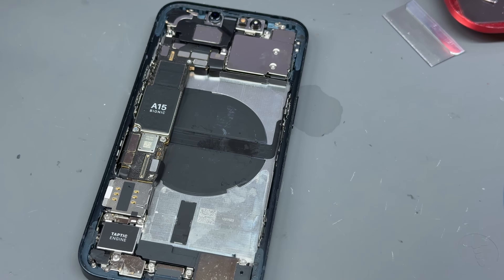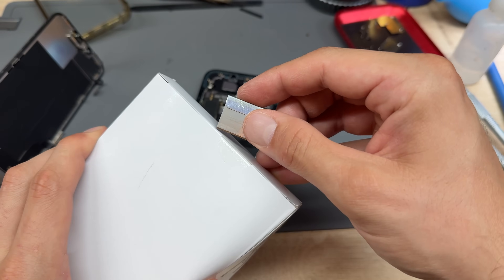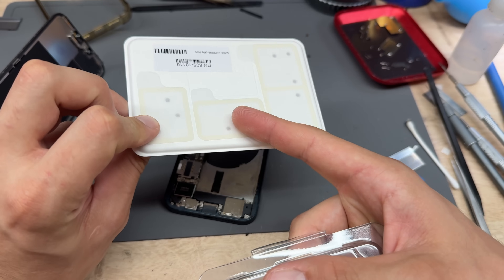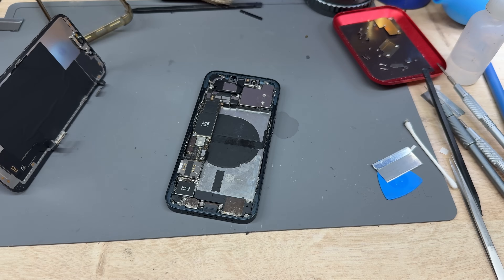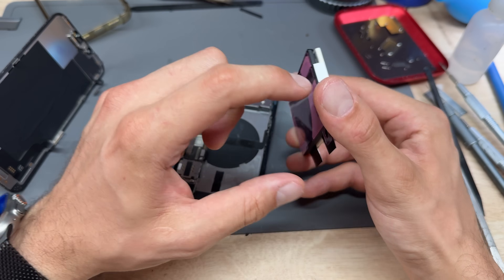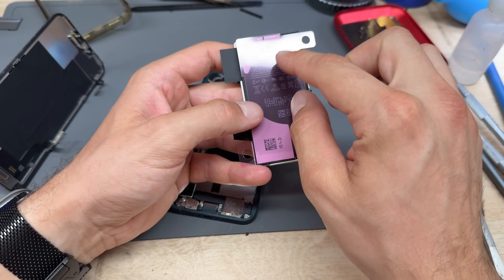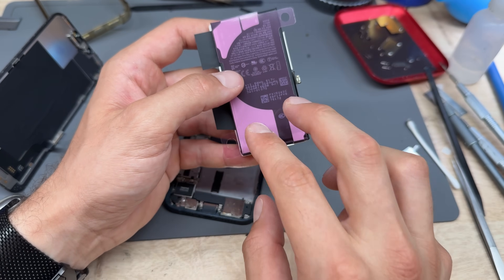The new battery that we're using in this video is a genuine Apple replacement battery. This video is sponsored by MobileCentrics UK — they are the supplier for this battery, and it comes with replacement screws should you lose them. The replacement battery comes wrapped in plastic to keep it protected. You might be thinking, what is this white thing on top of the battery? Well, that's the spacing block — that little bit needs to sit tight to the board and the bottom speaker, acting as a guide to make sure the battery sits exactly where you want it. On the back, you've got some plastic film, and between the battery and the film there's the adhesive that sticks the battery into place.